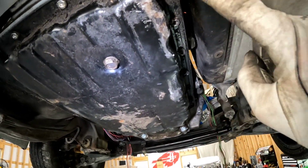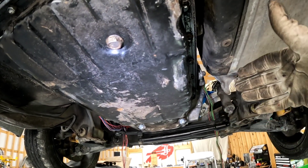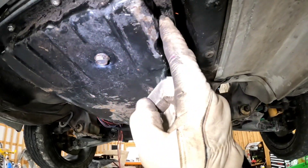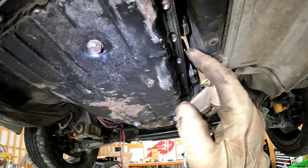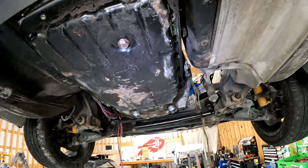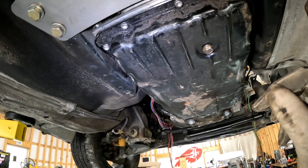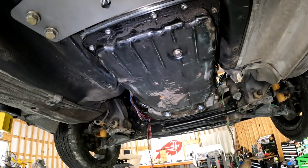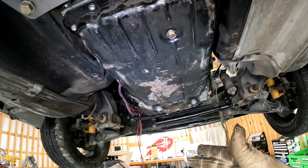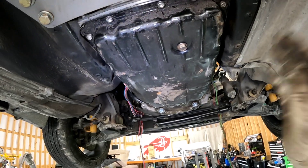The cable is going to have to come down through here and attach to this side of the transmission, controlling the shift lever. Plus we've got automatic transmission coolant lines and it's really tight in here. So I'm going to cut here — this is structural, so I'll have to make a box inside the car to reinforce it once I'm done, but that'll free up room for the cable. I'll also pull this pan because it's junk — replace the pan, replace the transmission oil filter, pull the valve body, put a Transgo shift kit in it, put everything back with a new filter, and put fluids in.